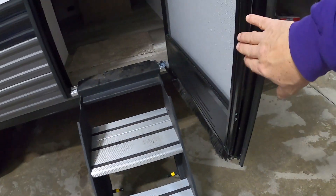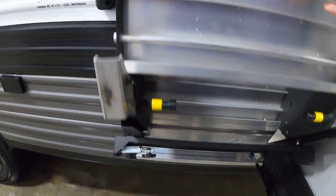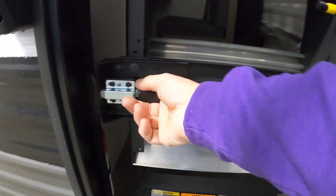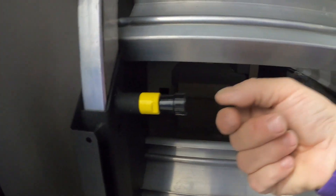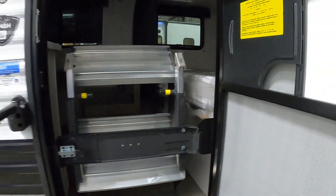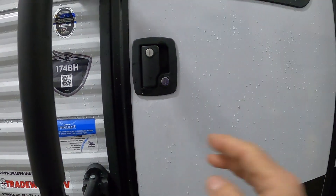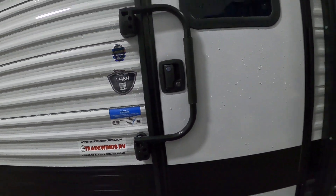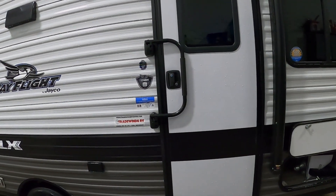Now the steps — be careful bringing them in or out because of the way your door sits. They're also adjustable. Watch them when setting them — pull on this, move the leg to the height you need. Great for unlevel ground. Before you leave the dump station, lock and deadbolt this door. Lift and turn that handle — that's how you want that door to travel.